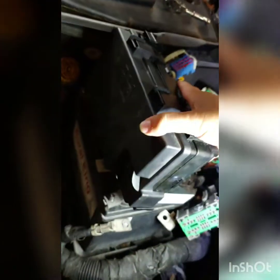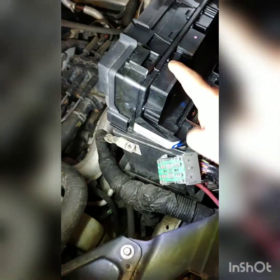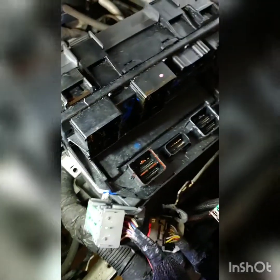Then you just hook your wires back up. This is the same part number as the old fuse box. I switched lids on them because this lid on the wire just has this, but I figured I'd just go ahead and switch it. That is the same part number as that one, so everything should work. My AC should start working on my blower motor, because there's a printed circuit board right down in here that runs along — it's got little relays and stuff on it, and I think that's what went bad on that old one.